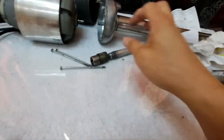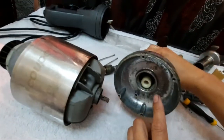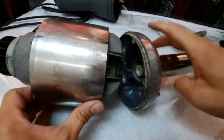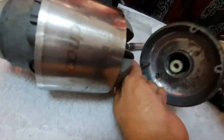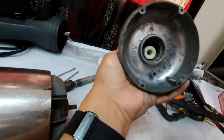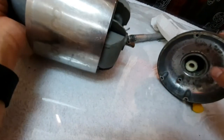Now we can reassemble this back to the housing. Insert this back over here — these two screw threads should cross-match here and here since they have the same distance. Previously before I dismantled this I put a marking so that I can easily cross-match it. Make sure that the driving shaft and the rotor shaft are properly connected. The easiest way is to find the slot inside, center the shaft over here on the slot, so that it centers on the middle of the screw.